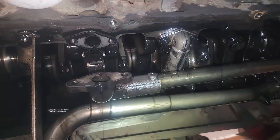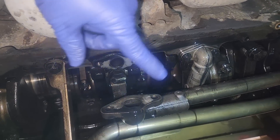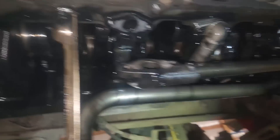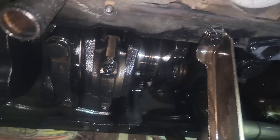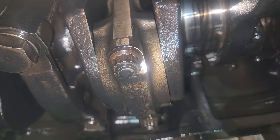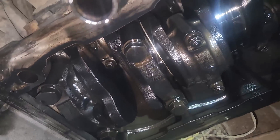Getting ready to pull the pickup tube, I see a lot of similarities between this and a CAT. The sump tube runs right into the block around cylinder three, and this one has a gasket. It's gear driven off the front. This is a two-bolt rod style — actually two nuts. These are 12-pointed style nuts, and I guess those are not supposed to be reused.